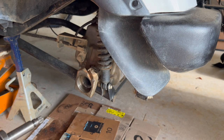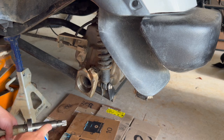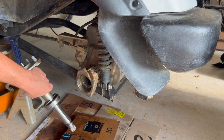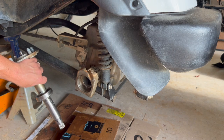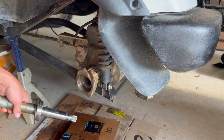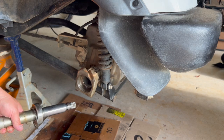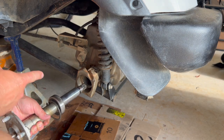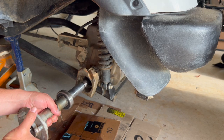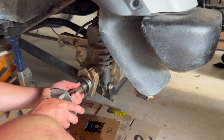I'm going to do my best to keep my hands out of the way, but I don't have a tripod short enough to shoot the correct angle here. So I'm going to spray this down, make sure everything's off, and let it drip dry a little bit. Brake cleaner dries super fast — you can see it's already drying, it just evaporates. And now I'm going to slide this in. I've already sprayed brake cleaner inside the hole. I've got to get these teeth to engage so that can go in far enough, because the bearing has to go in far enough for that split ring to go in as well.